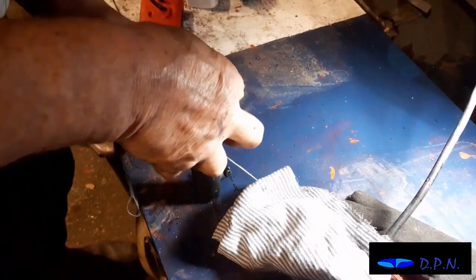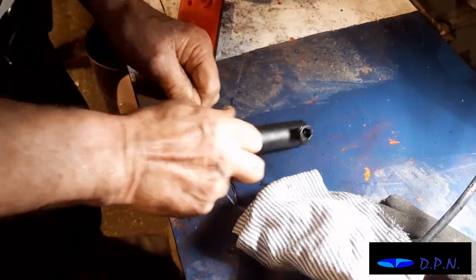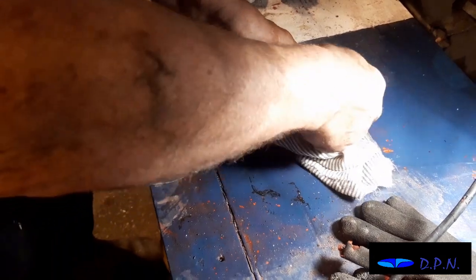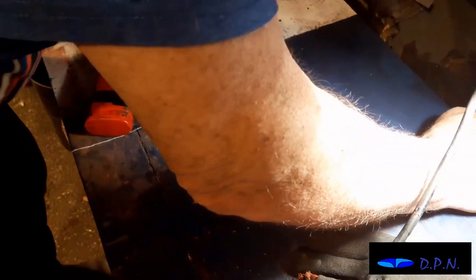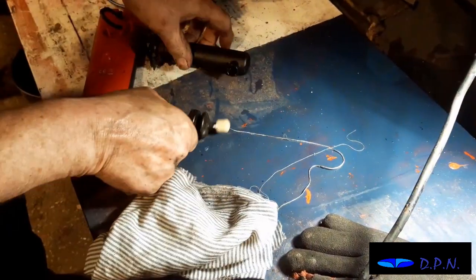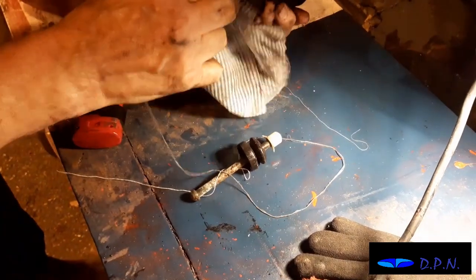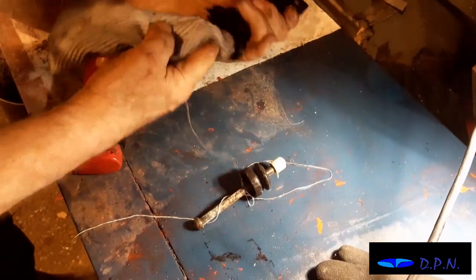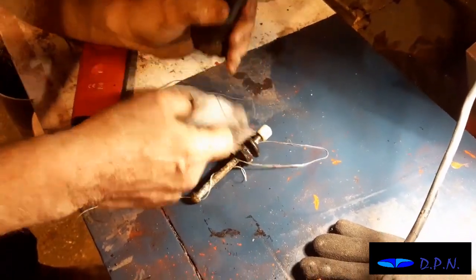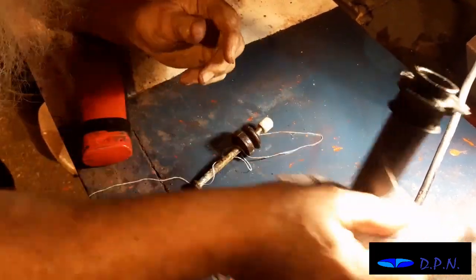Right, so as you see there, and we're doing it now, we're able to push it up and down, so it appears that the piston action is not seized at all. That is going up and down and springing back as it should, with very little resistance, although some of the fluid's been lost, so you couldn't just straight away connect it up, because you'd technically be putting an airlock in the system. We've confirmed that this slave cylinder, as far as we can tell, isn't seized, which makes us think it could possibly be the master cylinder that's seized.